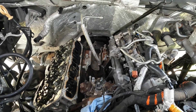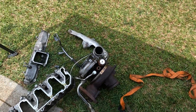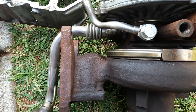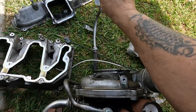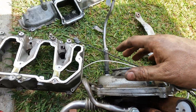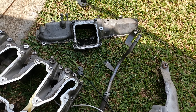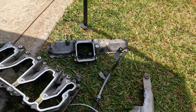Here is the turbo - you're going to have three mounting locations right here, and here's your oil feed. It does have a flex fitting on here but you just don't want to over flex it because it can bend and break. This is a coolant line right here - I did have to take that off as well. On the intake manifold, do not forget about the bolt inside of the intake because a lot of people tend to forget that one since it can be covered up with carbon and soot. These intakes can break pretty easy but luckily they're not crazy expensive.